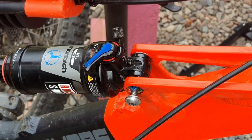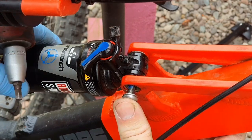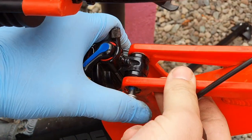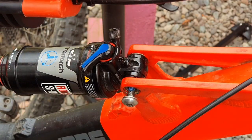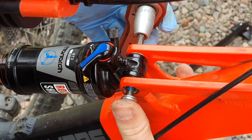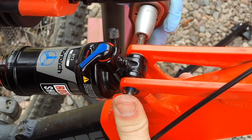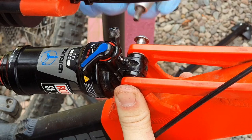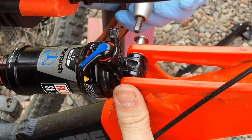There's a reason I put the screw bolt back in its place — what you'll find is it's a very tight fit and you might not be able to push it all the way through depending on how much maintenance, how much grease, if it's a hot day or cold day. So what to do is leave that in place, put a bolt on the other side, and when you turn it put pressure on your thumb as you're turning and you'll find that it starts to move and then drop out the back. It just keeps it dead easy to get out — just unscrew the whole assembly.